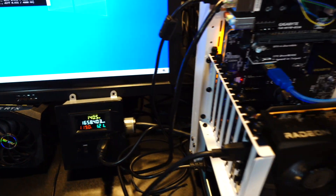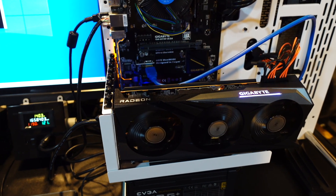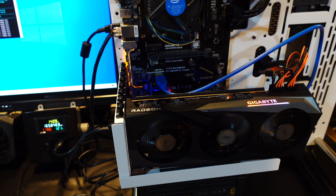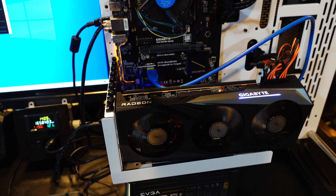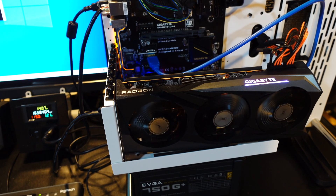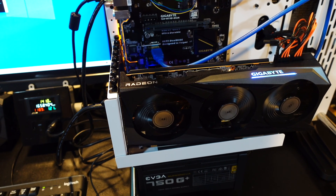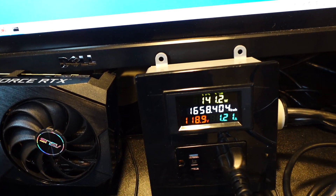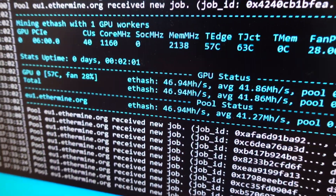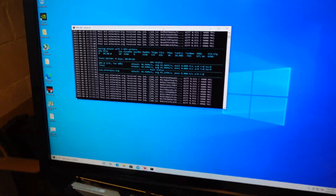Give it another second and then we're going to call this good. If you guys are new to AMD GPUs, they do take a little bit of work to get them where you want them. There's also sometimes additional work you can do when the BIOS gets modded — you've seen that on all the previous generation AMD cards, but nothing yet for the new series, at least that I'm aware of. But one thing we still can do is modify using More Power Tool to bring down the wattage. Maybe there'll be some BIOS mods in the future. So 46.94 — we'll call this 47, still going up. Successful: 110 watts for 47 megahash.